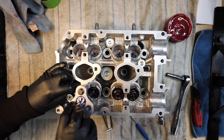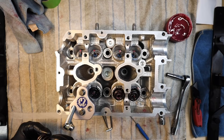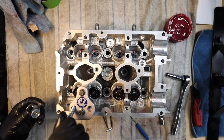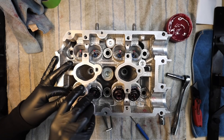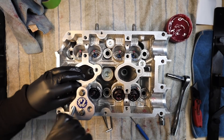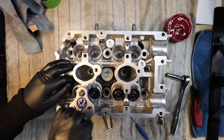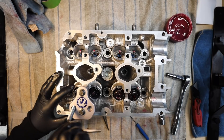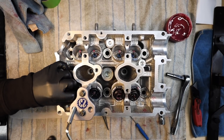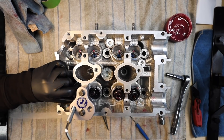Some keepers are going to give you a hard time and won't want to cooperate — that's normal. If everything looks too tight on one side, try rotating things slightly; that's sometimes all you need. If it's not cooperating, pull off the tool, go back in, and readjust the spring retainer and top hat to make sure everything is sitting right. Don't rush, don't force anything.